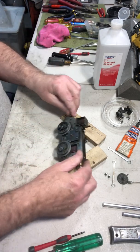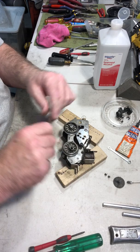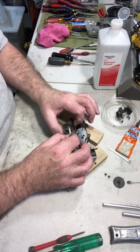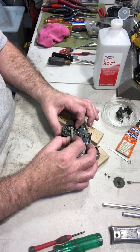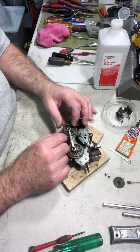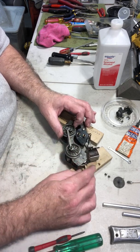And to do that, I'm going to synchronize the cross rods and so on back again to make sure I have that right. So as you can see on this side, just to show you what happens, I just put that wheel on random. I didn't line it up yet. But you put this cross rod on, even if you turn the wheel around, you can see I can't get the whole of that wheel to be exactly where it wants to go. So even that's close, but look at the rod. It's at an angle. So you need to have these lined up where this is parallel with the edge of the frame, and that hole ends up right there.